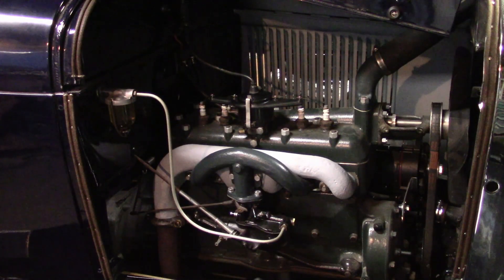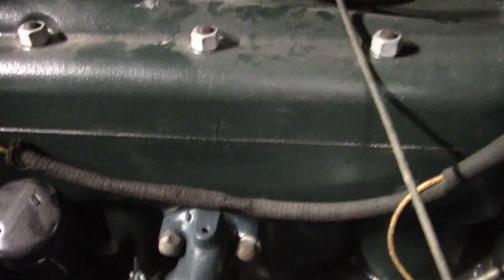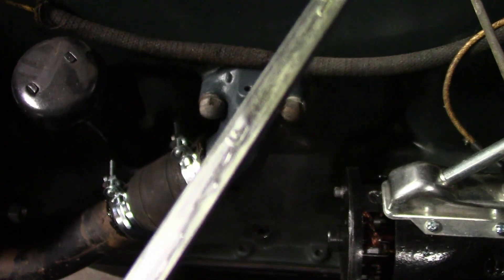I'm pleased to say everything seems to be working — it fired right up and it's pretty quiet. It's not knocking or clanking. I think the exhaust manifold is leaking, but that has nothing to do with the engine itself. It's not throwing coolant or oil anywhere. We checked the temperature of the cylinders while it was running and they were within about 20 degrees of each other, which is just fine — it's firing evenly on all cylinders. Let's check the oil. It's perfectly clean, no water in it — in fact it's so clean I can barely see it on the dipstick.